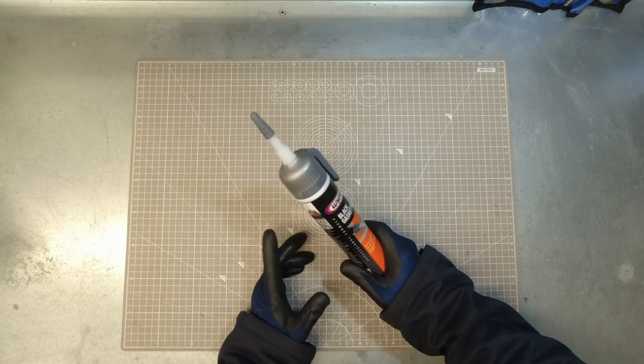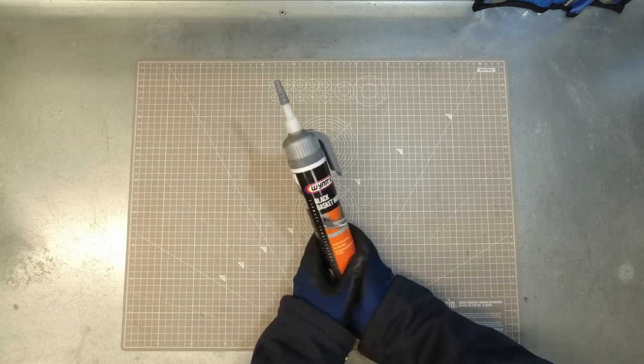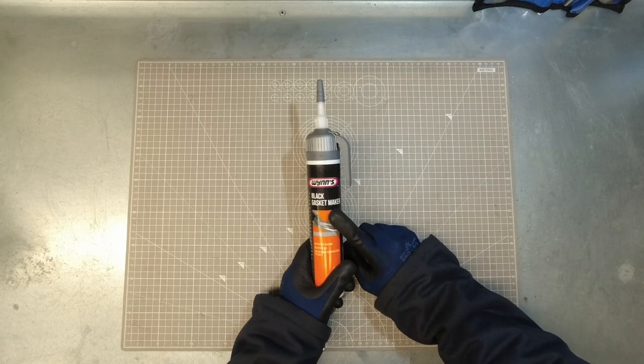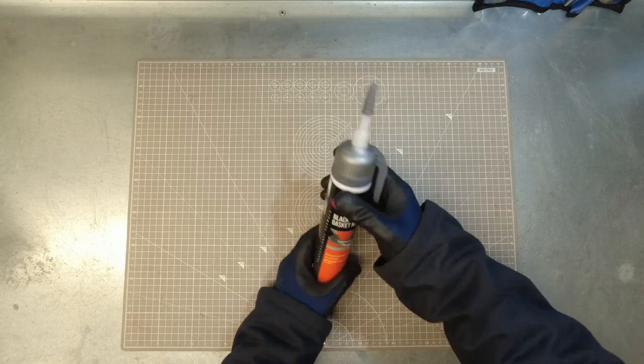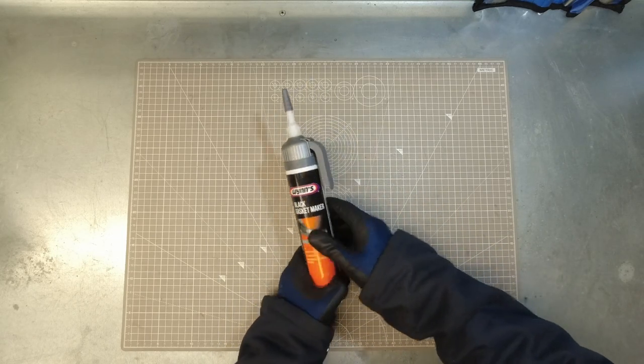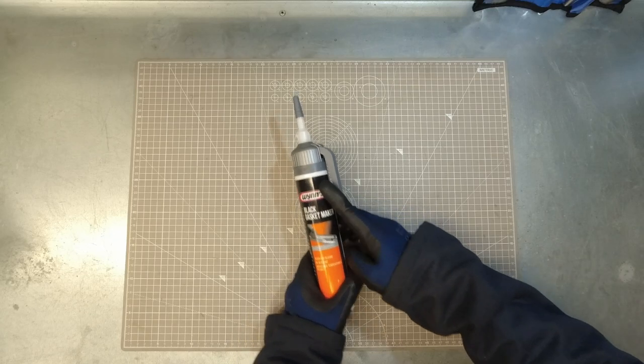However, before we do, we need to put some beads of sealant on the cylinder head. I've got this Wynn's RTV sealant. I like to use this for ease of application. You can set your bead size with it, and it also comes out well as it's in a pressurized can. I'll leave a link for this down in the description.